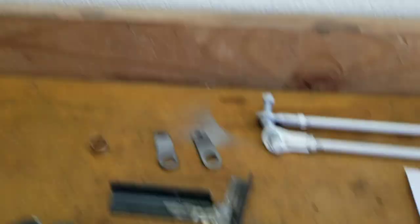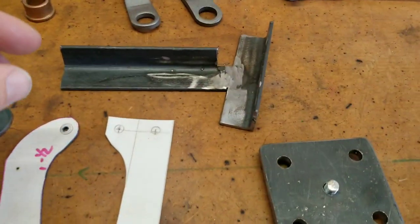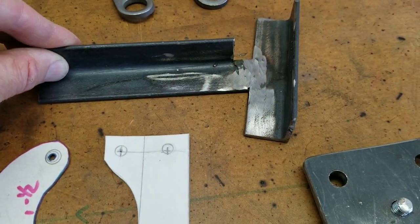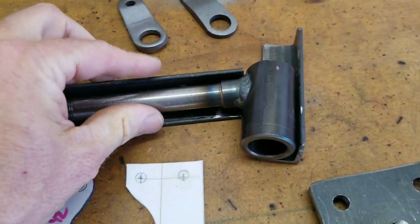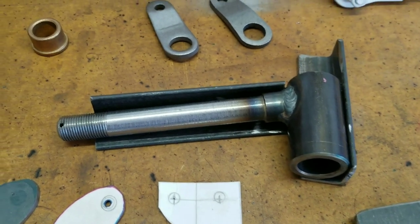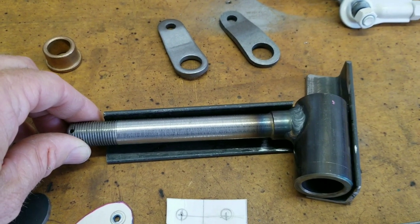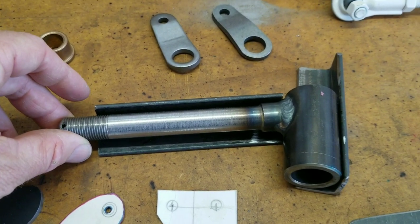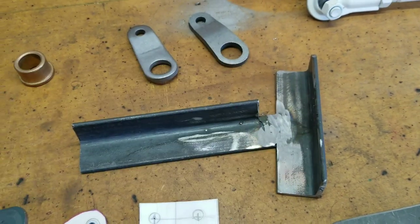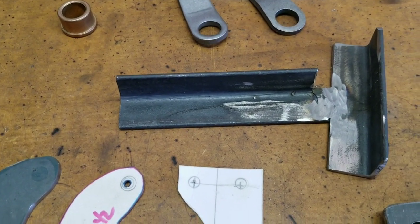To get the KPI, I used this tool here to find 14 degrees and a couple pieces of angle iron, and I welded this together so that when we weld it at the shop, your tube fits in there, the bolt fits in there, and you get 14 degrees every time. You can make this over and over again — it's basically a little fixture. You've got to space the bolt up so it's at least parallel, but that works out great. That way Roy didn't have to struggle with making it work properly.